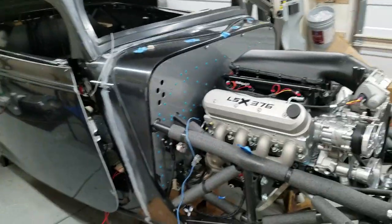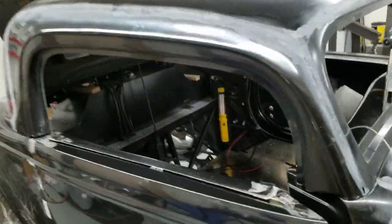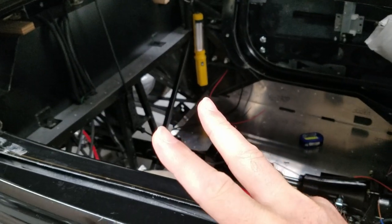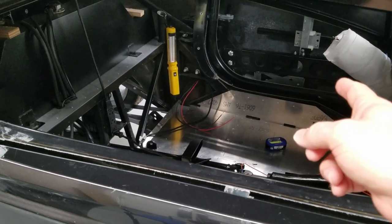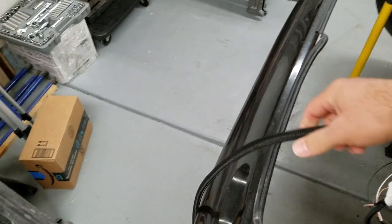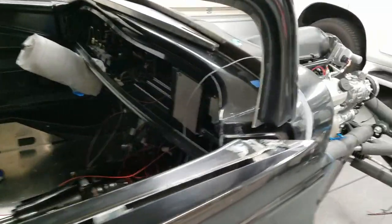And then of course I told you I got the battery. So that means I have basically four areas of working. The front area, what I'll consider the first project. Then the 10 pin cable coming back and the relays back here, that's the second project. The third project is inside the doors. I got door poppers, which I haven't installed yet, and the power windows. And then we're looking at the whole trunk area with the battery and all this cabling, which of course, what's nice is once I cut this, I get the sleeve and I get the cables, so I get extra stuff off of that that I could reuse somewhere else.